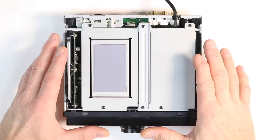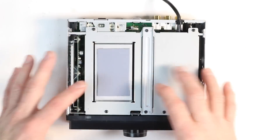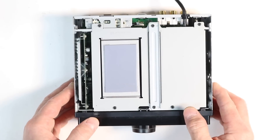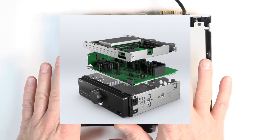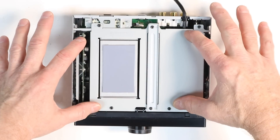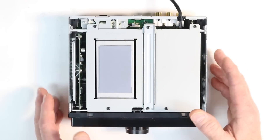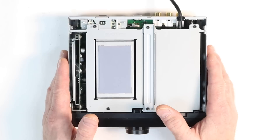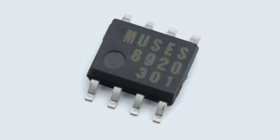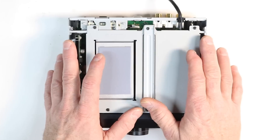Now let's talk about the general technology built into this. We've taken the top off the radio — one of the things really impressive is how much is filled up inside. If you've ever seen a modern radio, there's nothing inside anymore, but this is full to the top. It has a rigid dual-layer chassis for clean distortion-free sound. What would normally be the CD drive space is instead built this way to separate circuit boards for cleaner sound — four times as rigid as a regular radio, separating analog and digital circuitry to prevent noise. Hidden inside is the MUSES8920E high-end op amp, which provides authentic depth and detail for everything you listen to.